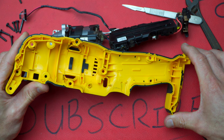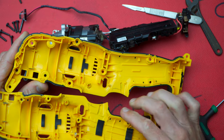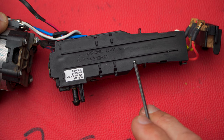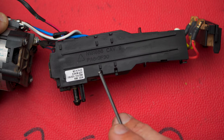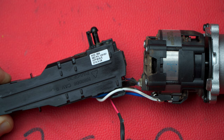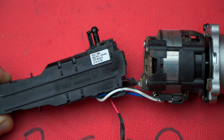Okay, enough about the switch. The other half of the clamshell looks very much the same as the first half — it's also got these little rubber inserts to suppress vibration, however underneath the switch there are no rubber inserts like this one had. The housing for the switch and speed control underneath here is enclosed in a PA6 glass fiber reinforced 30% — quite a strong nylon enclosure. I can see what I'm sure is just a part number — CAV9 — and a couple of other little database numbers that aren't going to mean very much.